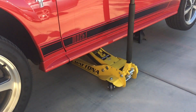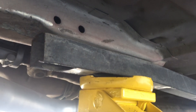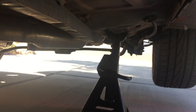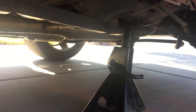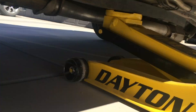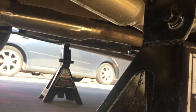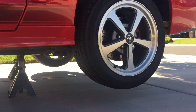The first thing you need to do is put the rear of the car in the air. I like to lift right about here, and that's nice if you have the subframe connectors. You can put the jack stand on the torque box, or move it over to the subframe connector in the back. Keep in mind the car will roll now because the rear wheels are not on the ground, so make sure it does not roll. Put wheel chocks under it — even a nice bag of salt will keep it from going anywhere. Make sure your wheels are slightly off the ground.